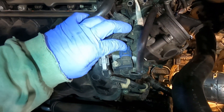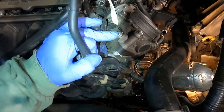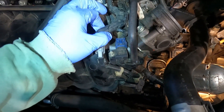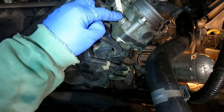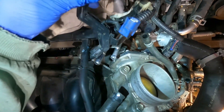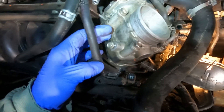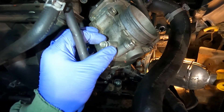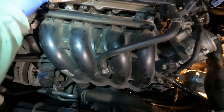We got this out of the way. We'll disconnect this connector on top as well. We may have to take this bracket off — there's no other way for it to come off. Disconnect that connector and that connector and remove the bracket — looks like a 10-millimeter. Pop those off, disconnect the connectors from down there, remove that bracket. I like to put the bolt back in its spot after removing it so I know where all my bolts go when reassembling.